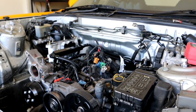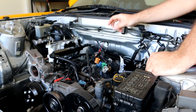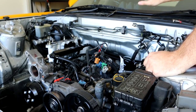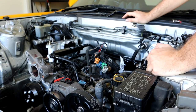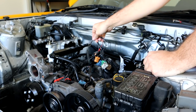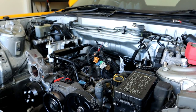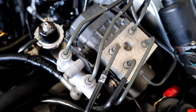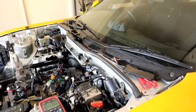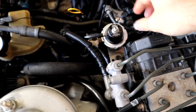My next bet is, because I disconnected so many grounds on the engine - this one here looks like a pretty important ground. So I'm just going to ground stuff and maybe that'll do something. I'm just going to literally touch this to the block and fingers crossed. That is definitely not tight - I found a ground that works. Look at this though - that is definitely not correct. Did I even tighten that? This might be a reason. We'll tighten that one up real quick.